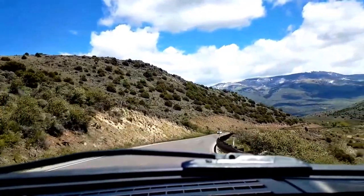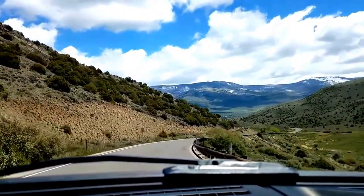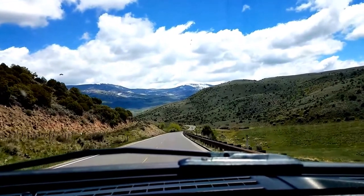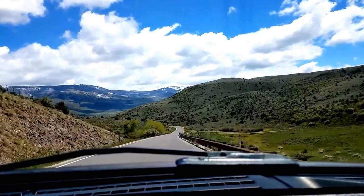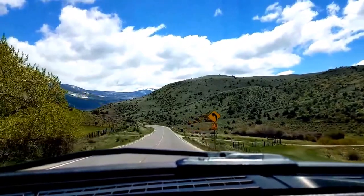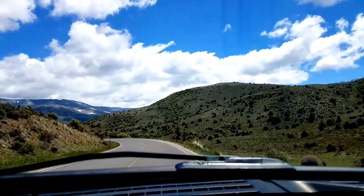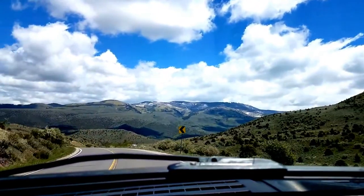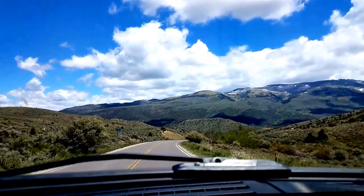I'll let you know if we need to engage the brakes. We're going back up to 50 miles an hour — the engine is still holding this back. I'm going to maintain about 40 mph to keep everything under control. Still not touching the brakes. RPMs are coming up to about 3,500 and we need to slow down for this curve anyway — still not touching the brake. The vehicle maintains control and I don't have to touch the brake going into this corner. This is with a significant load on the trailer, so I'm extremely happy with that. Both uphill and downhill — very, very impressed.